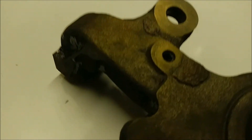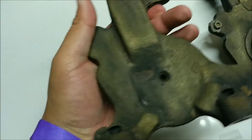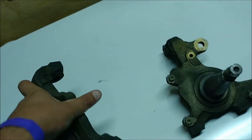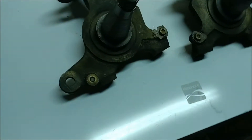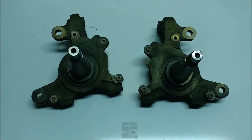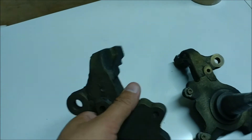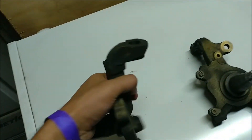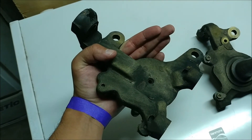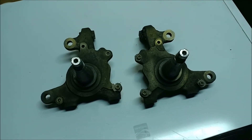I pulled them out of the last dip and as you can see they're super clean now — all the rust is gone. I'll just hit them with a coat of paint so they don't rust over again, though that's not much of a problem here in Southern California. Eventually I'll get these modified into drop spindles for my truck. I really recommend that Evapo-Rust stuff — it worked really well. At the beginning of this video these were horribly covered in rust and now they're super clean and ready to be used again.